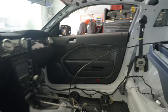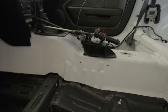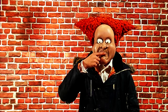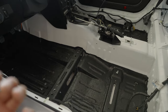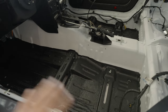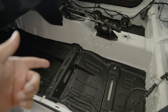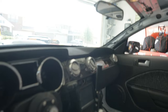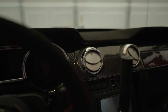On the inside of the Mustang, I got real busy — in fact, I gutted the entire interior. The reason I did that is because the carpet was moldy and smelled super bad. The only way to get the smell out was by removing the carpet, and once I started it was coming out in chunks, so I decided to just remove it and any of the interior since I was going to put racing seats in anyway. The dash had a crack in it, and you can't see the crack anymore because I went ahead and flocked the entire dash — now it's like a black suede all the way across and you can't see any cracks, which is super nice.